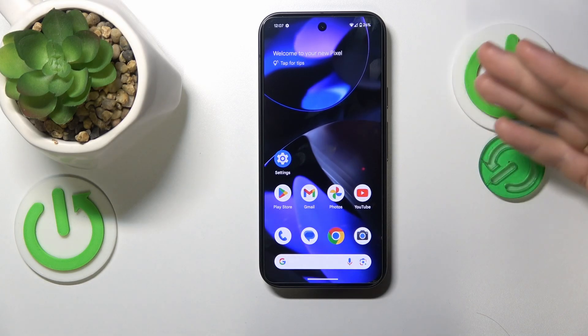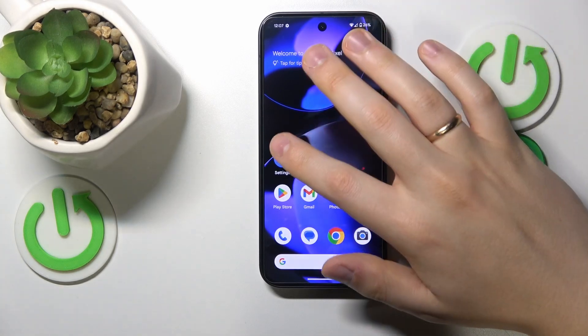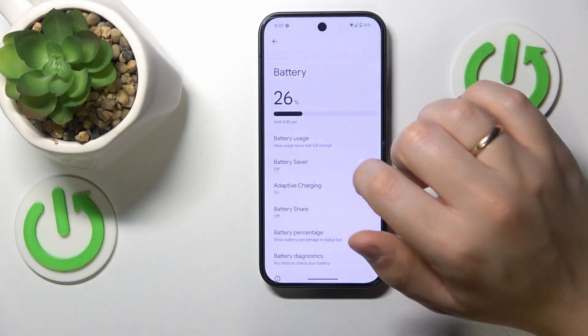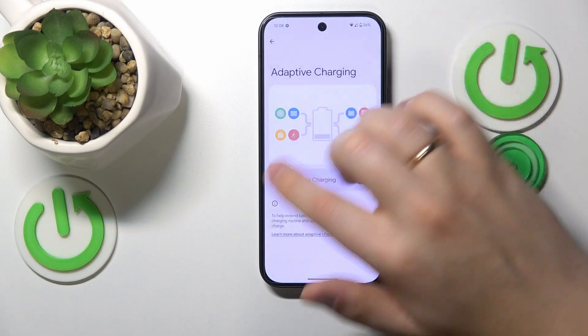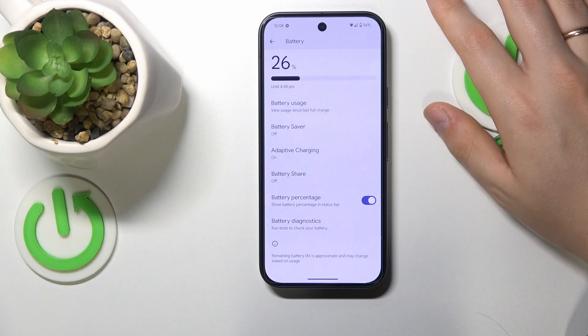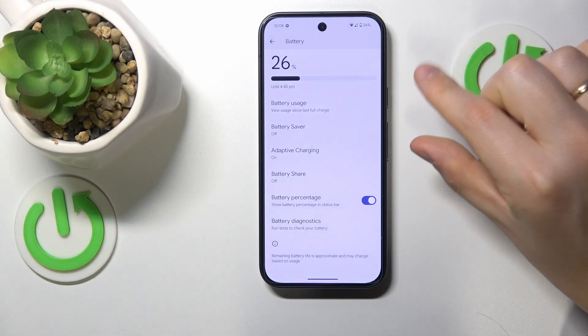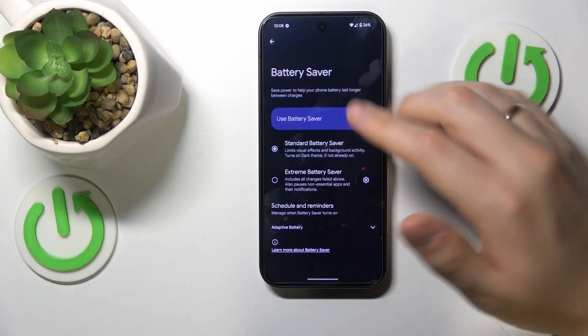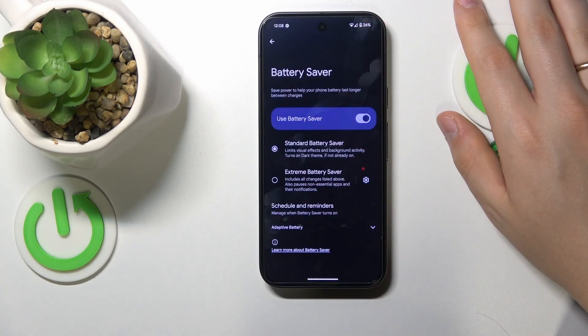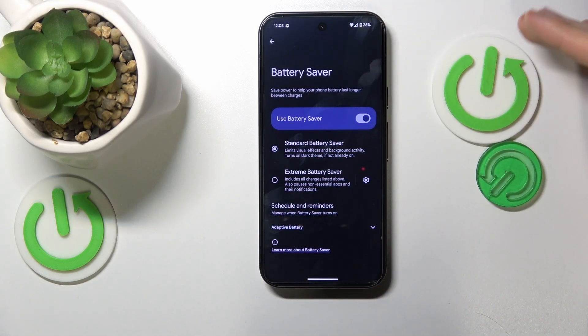If you have to leave it somewhere outdoors, make sure it stays in a shadow. Now if overheating has already occurred, go into your device's Settings, enter the Battery category, and switch on Adaptive Charging to safeguard your battery further — allowing it to learn from your usage patterns and calibrate itself for efficiency. Also switch on Battery Saver to restrict performance, since less performance means less heat accumulation and faster cooling.